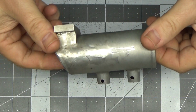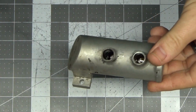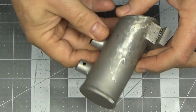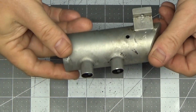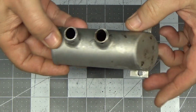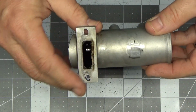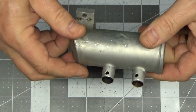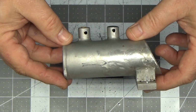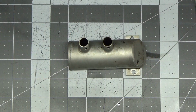Okay, just so we've got the same lighting as I had initially. Here's that really nasty looking exhaust. 19 hours sitting in that Gunk carb cleaner, and this is what it looks like. Is it perfect? No, the exhaust wasn't perfect to begin with. I could have let it sit in there for a full 24 hours and I'm sure this would come out completely perfect. But I mean, it does work. It works quite well if you've got the patience and you don't mind the smell. That seemed to be quite successful.